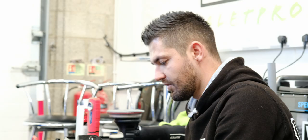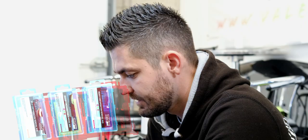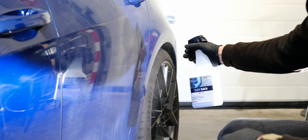We've got our clay rider which is our clay lube, and we've got our heavy contamination removal bar which is our blue one. We've got three different types — blue is heavy, yellow is medium, and orange is mild. This one is perfect for hard type paints like German cars and for doing your deep decontamination. This will cause marring so you will need to polish afterwards, but it won't be so bad due to the clay rider aiding it. The clay rider reduces marring but unfortunately because of the type of clay bar you are going to get some marring from it.